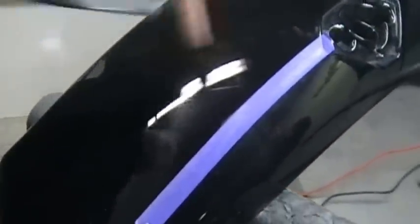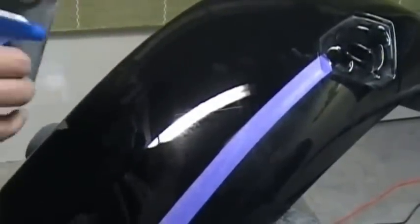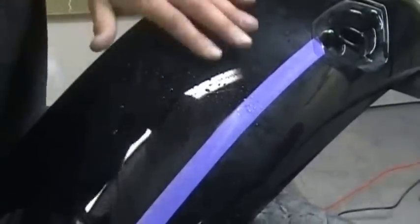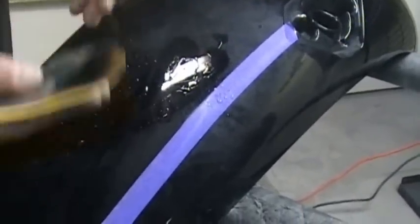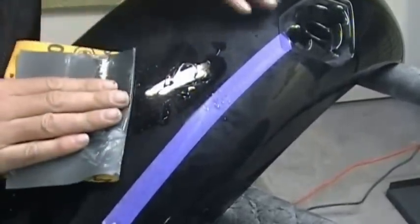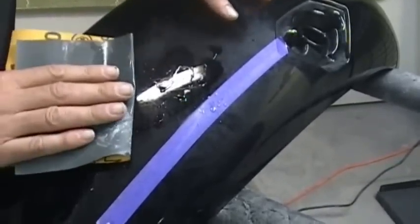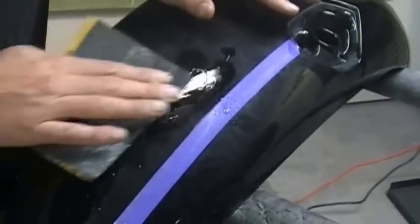What we are going to do is start out with 1000 grit first. 600 is probably too coarse, so we are going to start with 1000 grit and see how it goes. Now I told you to use that foam pad, but what I am going to do — the foam pad will work, but if you can keep your fingers flat and don't do that two-finger gouge, use four fingers, keep them flat. You can actually control where you push on the scratch. The block is going to sand that whole big area — we don't want that. We just want to lightly sand this scratch.